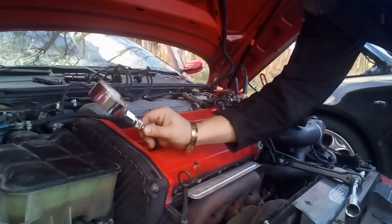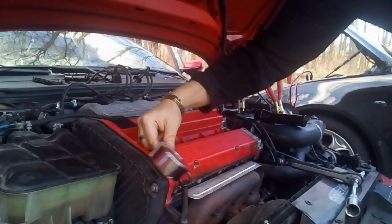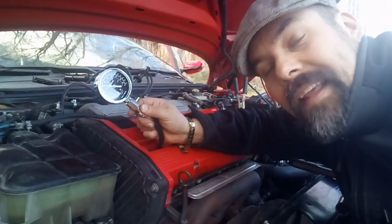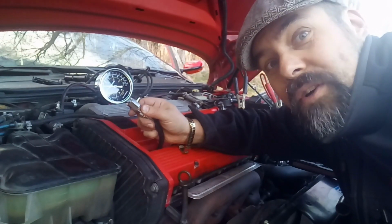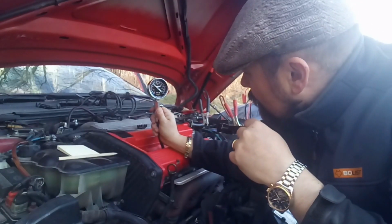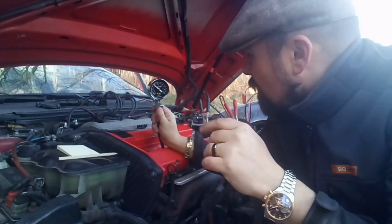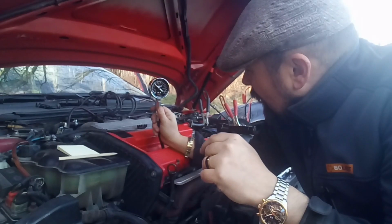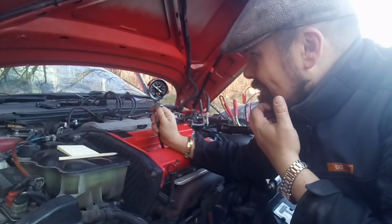We have a compression now of 8 bar. If you can see it, 8 bar. It is 8 bars compression. I forgot paper and pen. I need to go there, get it. Second test is lower, 7.3, 7.4, somewhere around there. So it's 10% lower, almost 10% lower.